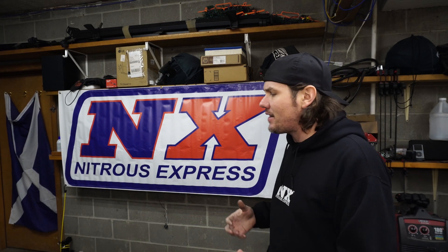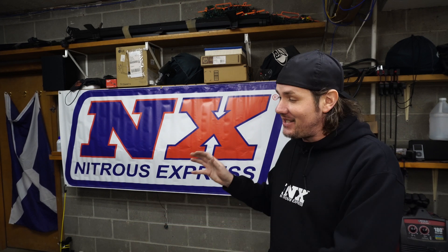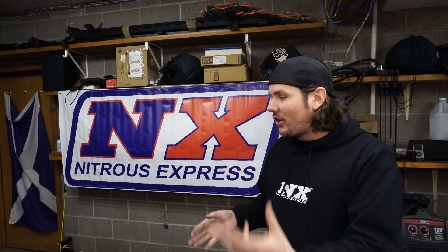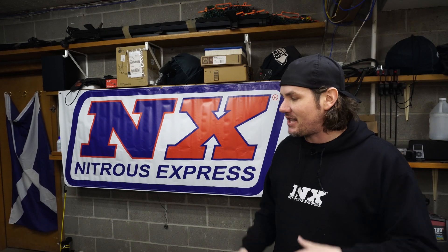Go check it out — I'll put a link down below if you are looking for progressive. Why do we run progressive? The big thing about progressive is it allows us to ramp up the power so we're not shocking the motor, not shocking the drivetrain, which on Project Country Club is very important because this is not the most robust motor and transmission combination. Even though we're going to do some silly stuff with nitrous, we don't want to melt something down or break parts the first time we apply nitrous to this setup.